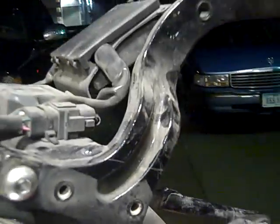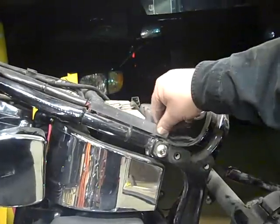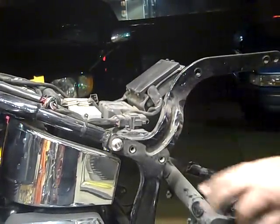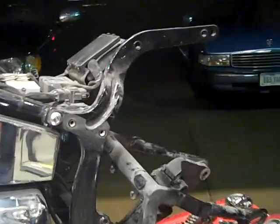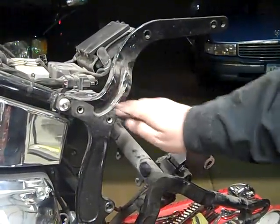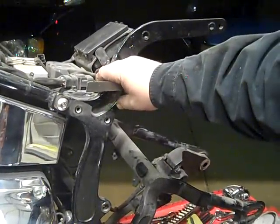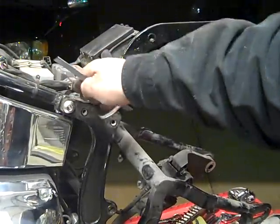The idea behind the line was that it flow and follow this line right here as closely as possible. The reason the old rigid pan heads looked so nice is they had that clean, straight line that went all the way back to the axle — just a perfect line. We want to follow that line so that visually we don't have any interruption in it. We're going to start by cutting here, then leave ourselves a little bit of running room so when we go to work on it with a grinder, we can get that perfect line.